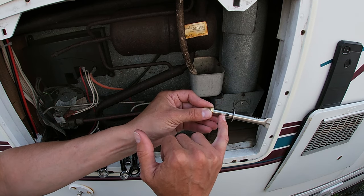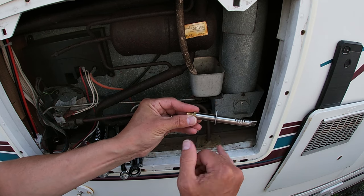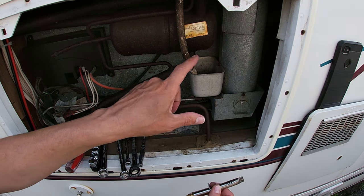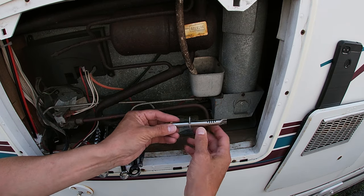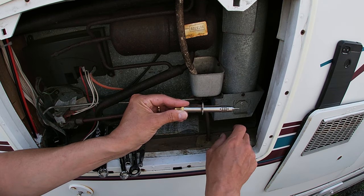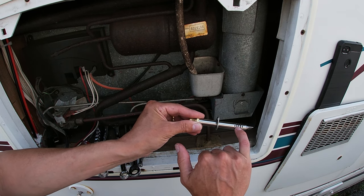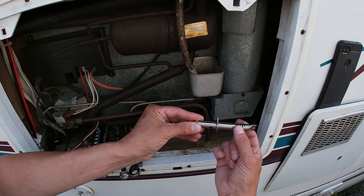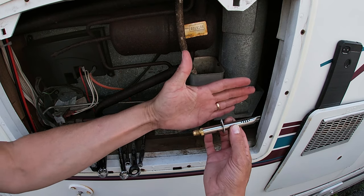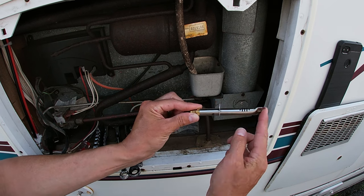If the oxygenation tubes are working properly, the next thing in line is the dispersion pipe, and this is what's wrong with this fridge. As you can see, there's a bunch of rusty stuff on the surface of these pipes. Inside this tube, a bunch of the rust has fallen down and gotten into the dispersion pipe. The flame is not dispersing properly in our dispersion pipe. We're going to take all this apart and show you the two components side by side so you can see what it should look like — and maybe you can buy one to fix your own RV fridge.